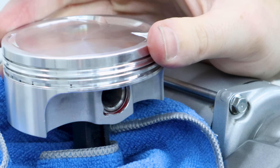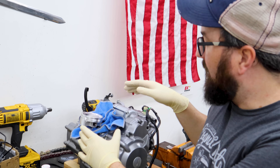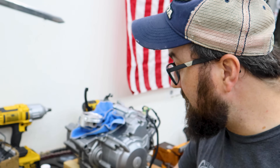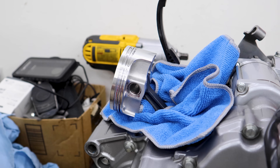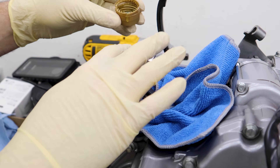You can totally put the piston rings on before you install the piston, but since you have to manhandle it a bit, I think it's nicer to do it after. Now with the head studs removed it's actually a little easier. First thing you should do with your rings is get them all gapped. If you know how to do it then do it; if you don't own a ring grinder, it's five bucks to have the guy who bored the cylinder gap them for you. Before installing the rings, I'm going to drizzle a little oil in here.